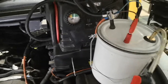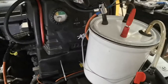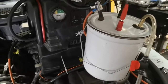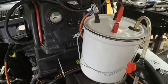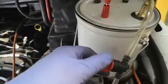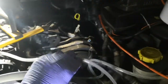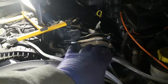If you want to do a DIY smoke machine, just Google it and it'll show you how to make one. This one cost me under £10 all in — the heating wire was probably the single most expensive component, but I had enough for a couple of uses. I've also added a little cut-off valve and looped a couple of loops in the pipe, just in case there's any liquid, so it can condense and drain back without going into the system.